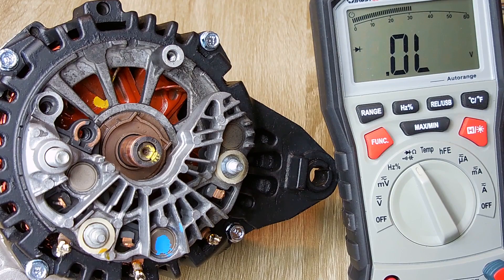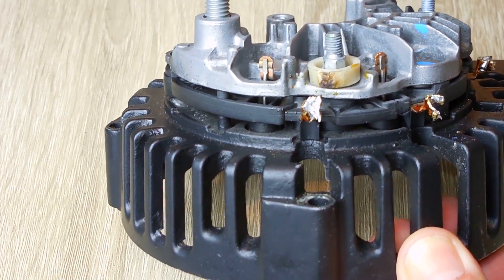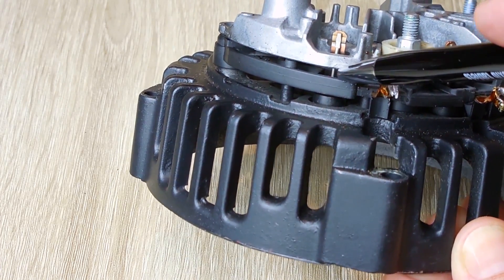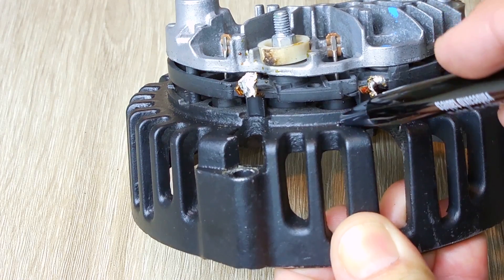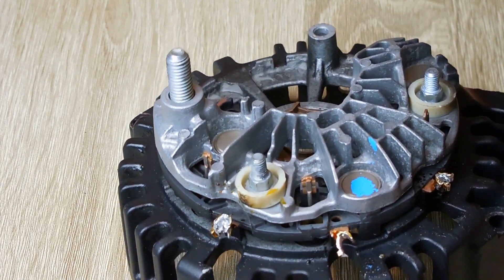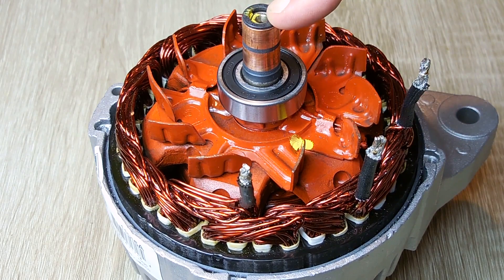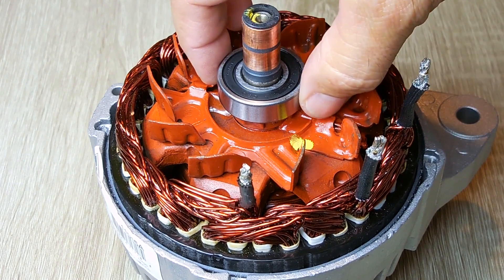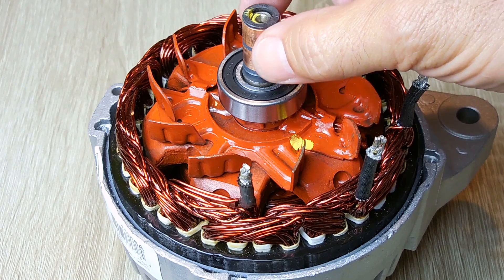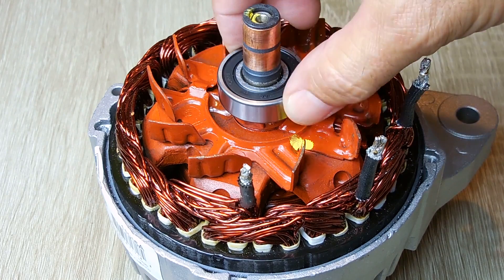I'm now going to desolder the connections for phase A, phase B, and phase C, pull off the diode block, and open up the alternator. With the cover off you can see the wire from the diode, the body of the diode — there are three on this side. Here's all the connections from each phase. You can also see the sealed bearing. If you have to change it, use a two or three-jaw puller hooked underneath — tighten it down and slide the bearing off the shaft. Take the new one, slide it over the slip ring, place a socket the diameter of the bearing's inner race over it, and tap down until fully seated.